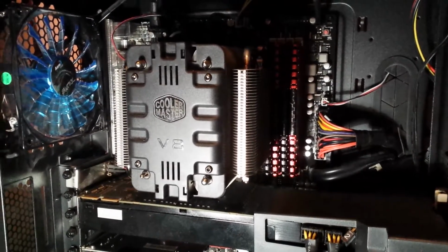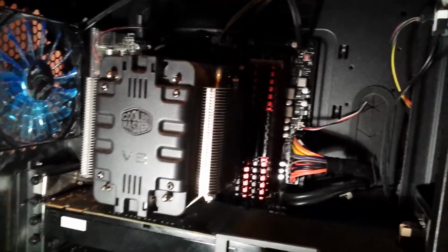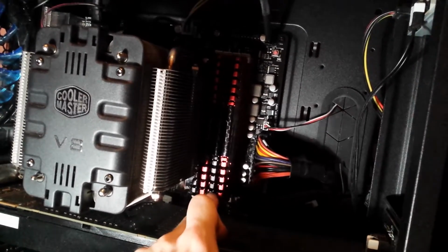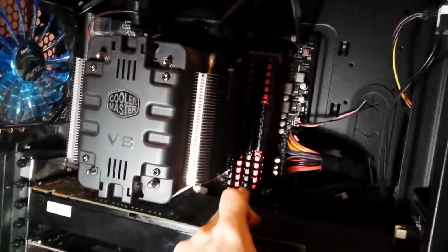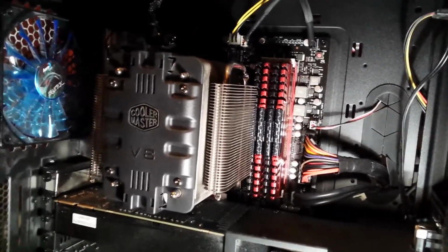It's very dark in here because I've decided to do this in the dark. So I'm now using a lamp, but this is what my computer looks like. I'm running an 8-core FX, I think it's called something like an 8120. Basically, it's about a year-old processor from when they first came out. So there's one here and one here. They're both 8 gig sticks of DDR3 1600 MHz RAM and 2 4 gig sticks, the same manufacturer, same megahertz. So they're giving me 24 gigs of RAM, and an 8-core CPU overclocked to 4 gigahertz.